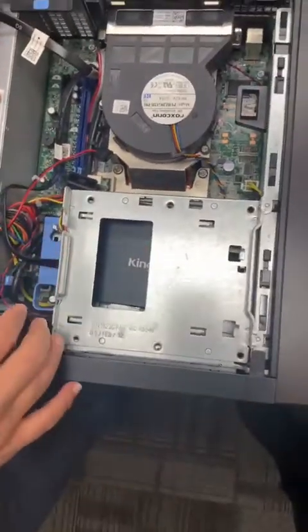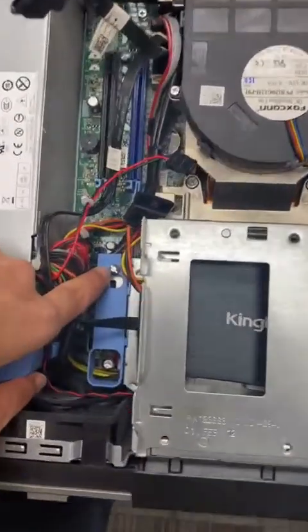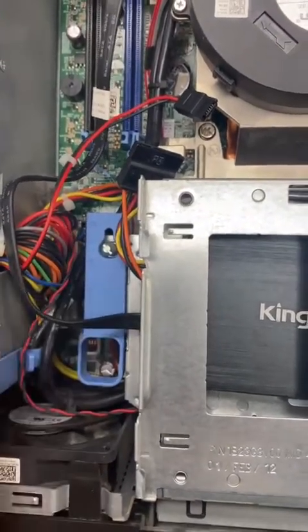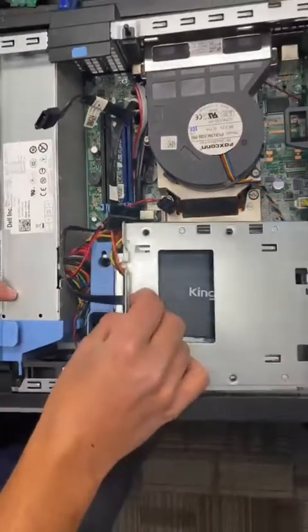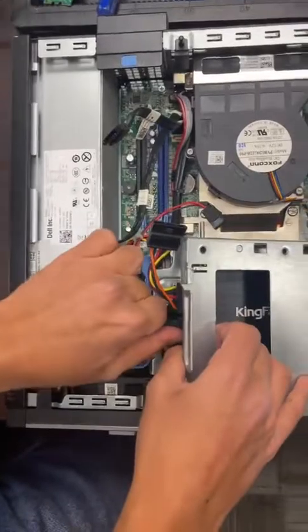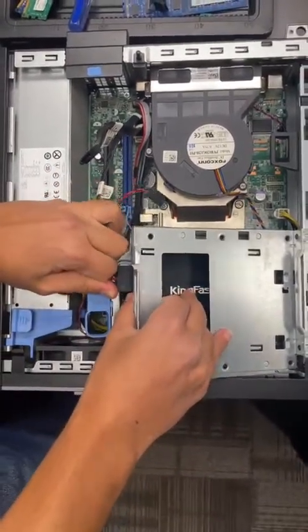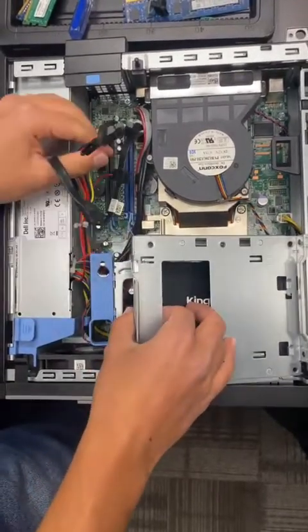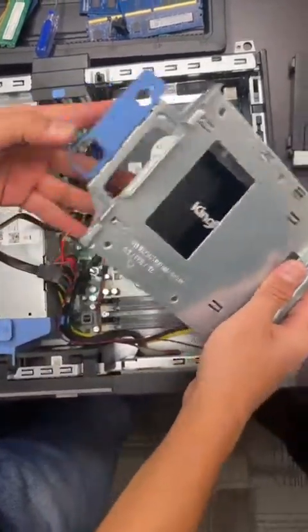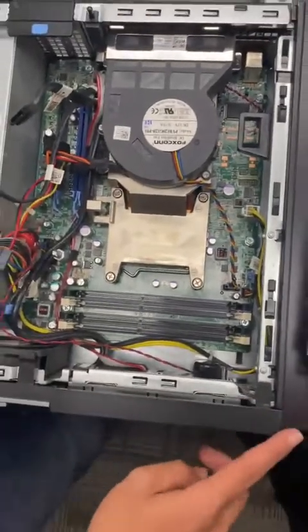Next, we need to release the hard drive so we have more space. The switch is locked, so with your finger slide it to the unlock position. Then lift the hard drive tray and disconnect the cables — there are two of them. Don't be afraid to exert a little bit of force, but try to be gentle and let them come out as smoothly as you can.